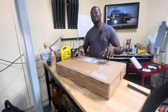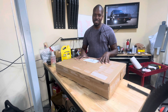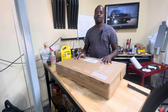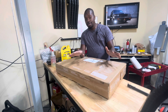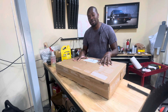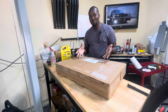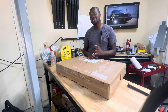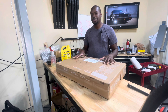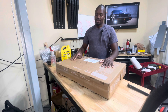As you saw from the introduction, there is a diagnostic tool in here — specifically the OTC 2000E. This is one of many scan tool options available in the late 80s and early 90s that will work on our cars. This will work on any Grand National, any turbo regal, anything from 82 to 87. This message is specifically for folks who do not have the 86 and 87 ECM and can't upgrade to the ScanMaster — there is an option that allows you to read diagnostic codes and live data on your vehicle.